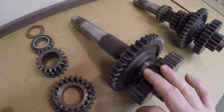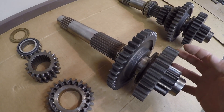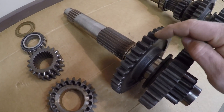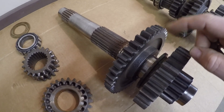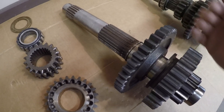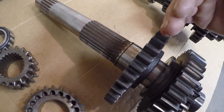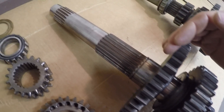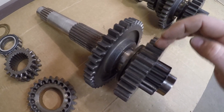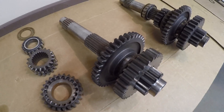One final detail regarding the similarities between the prototype shaft and production: even if this was a production top sliding gear shaft, this is about as far down as you can disassemble one of these. This gear is keyed to the shaft and it is an extreme press fit. Even if you could get this gear off, you would need to press it on in exactly the same spot for the entire transmission to work correctly. The service manual says if there's anything wrong with this gear or this shaft, just replace the whole assembly.